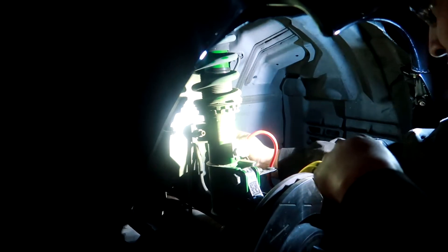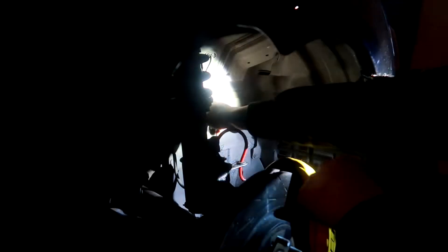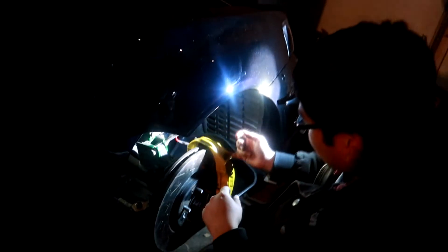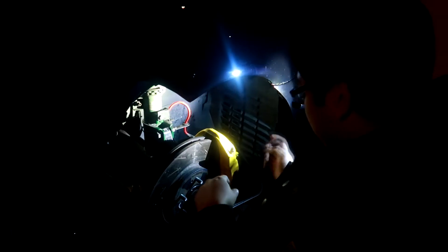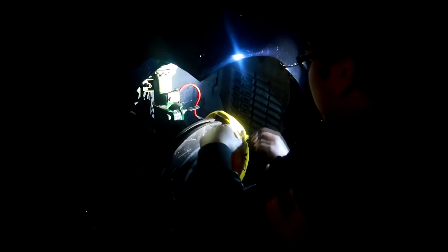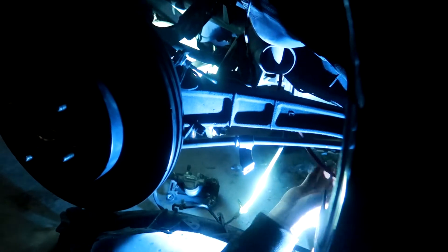We're draining all four at once, switching everything out to get rid of the old brakes. You tighten them up, and after they're connected we're gonna get the bleeder screws loose. Manny's on the rear now doing the same process — pretty much just connecting it, then we'll do the bleeding later.